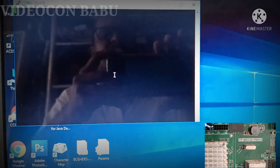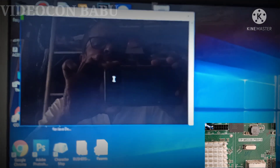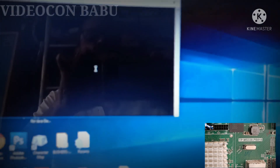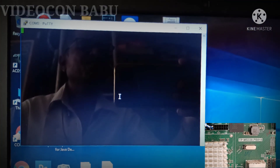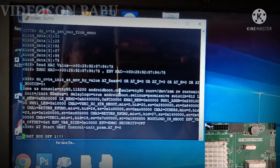The terminal window is opened. Now I am going to enter into serial print mode. I am going to switch ON the Android board using mains power. I got the serial print in standby mode.